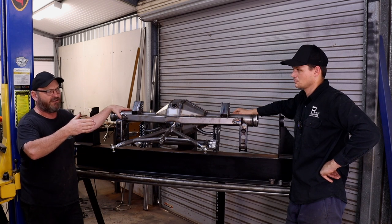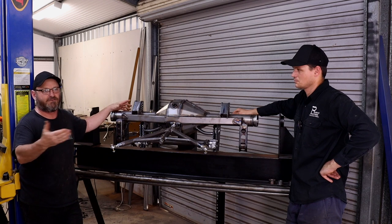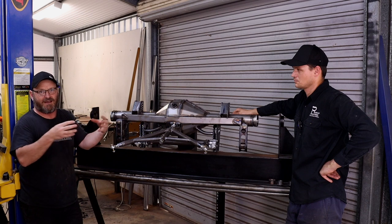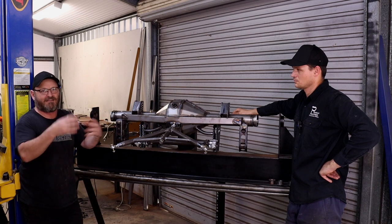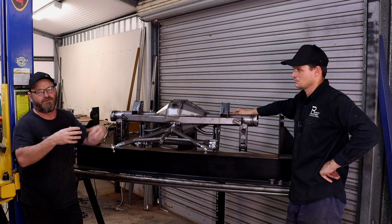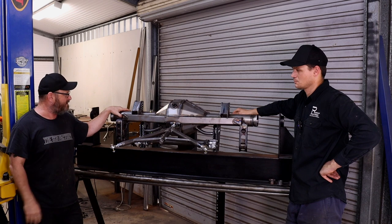I don't know if you explained earlier that the only real difference, apart from the extra strength, with the 40 spline is that they're not built to be equipped with a limited slip or any other type of center. So it's all axle and a full spool, which is what we run anyway. So it seemed like the obvious choice.